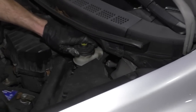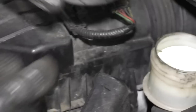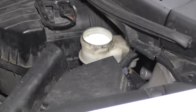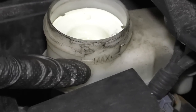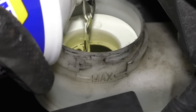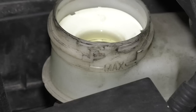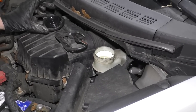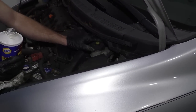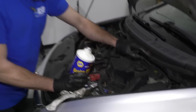We've got our safety glasses on. We're going to move over to the master cylinder and open it up. It says DOT 3 or DOT 4 brake fluid — very important to use those specific fluids and not DOT 5. I'm going to use DOT 3; you can use one that says DOT 3 and DOT 4. Fill it right up to the max line — being careful not to spill any, because brake fluid will eat the paint off your car. If you spill any on the paint, wash it off immediately. That looks close enough. Put the cap back on — we don't want moisture getting absorbed into the brake fluid.